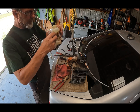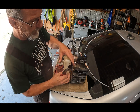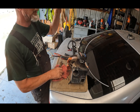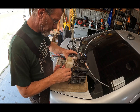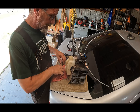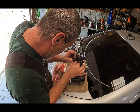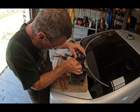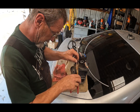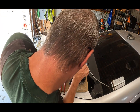We'll run that hose down there — that looks like it'll work pretty good. I'm going to cut this much of it off. Yeah, that looks like it'll work good. Now I've got to do this other end, same length. And the point of that is to be an air breather. There we go. Put the gas tank back on. Bottom hose goes onto that. So I don't need quite that much, I'm going to cut some off — about that much right there because I don't want to pinch anything. I'm going to go ahead and stick that back on the carburetor. There we go, nice and curved, no pinching. This one here, same thing — I'm going to cut some of it off, and we're going to make a nice curve right back onto it. There we go.